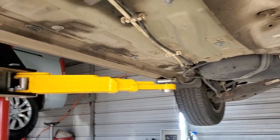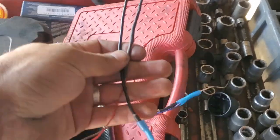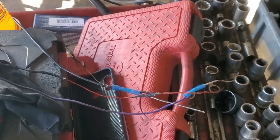Some of you might ask: the test procedure says if you find high resistance, repair it — but if not, replace the engine control module. I'm still not 100% sure about my probing results and whether the resistance change is due to the wire or my probing technique. The only thing that led me to do this repair was that messy splice. Hopefully it's the wire. But if it's not, then they'll need to replace the computer.